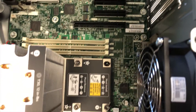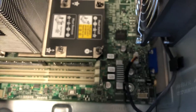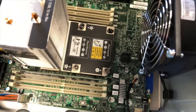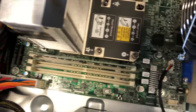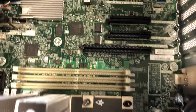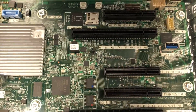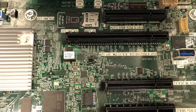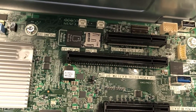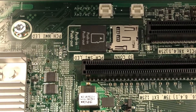You can see the three memory DIMM slots on either side — one is populated with a fully loaded DIMM. There's a big, beautiful heatsink, and notably there's no fan on it, so you'll want those air baffles to keep airflow going. It's an 85-watt Xeon, which is pretty remarkable for eight cores. There's also the ASIC that runs their ILO configuration and security — that's generation 5. And there is a microSD card slot, which I'm assuming is for configuration or a security operating system.